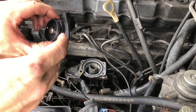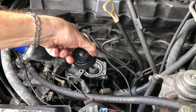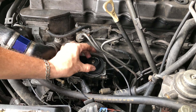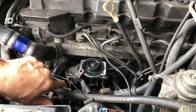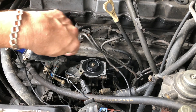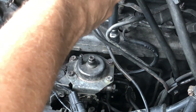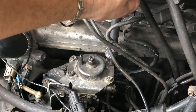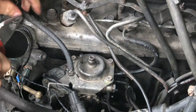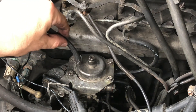Okay, so slide that up there. Again, our zero corresponds with the deepest point — the fuel pin is towards the front here, as you can see with the zero. I'm going to turn it 180 degrees. So now the zero is towards the front of the engine. Got our spacer on there, and just drop that down. If this doesn't drop down, that means somebody's probably played with the accelerator pedal or bumped the linkage and kicked the fuel pin out — you would just have to take a screwdriver and push that back in towards the front of the vehicle, dead center forward. And I'm going to put the cap back on. I have a tendency to over-tighten everything, so I'm going to be careful. This is the hose that provides pressure to the top side of the diaphragm, pushing it down or allowing it to come back up — so that's fairly important.